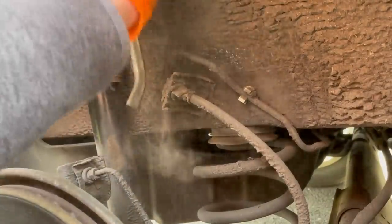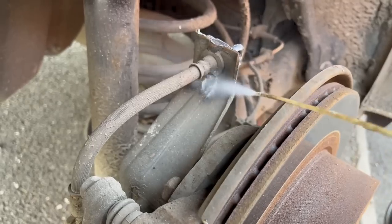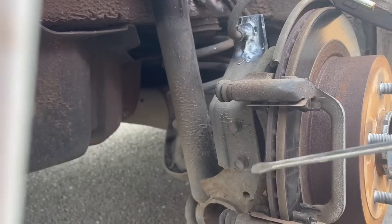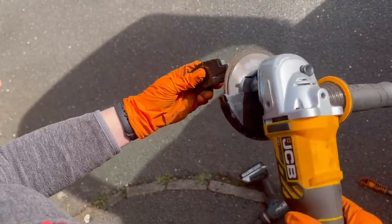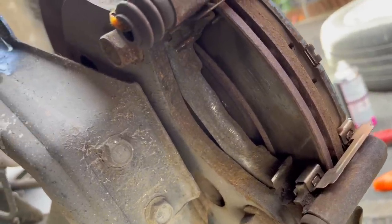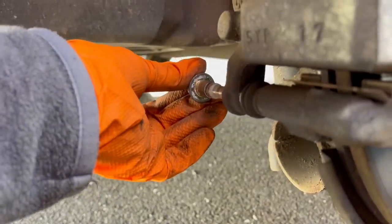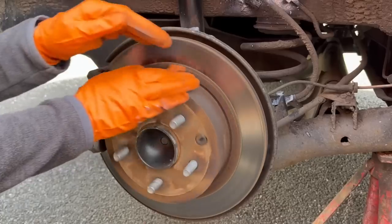Now we're onto the back wheels and here we often find the rear brake lines covered in mud and often much worse than this. There are four joints in the line that we clean up and treat as these disappear over the battery and aren't something we want to replace. It's much the same on the rear brakes as the front. The outer pads come out relatively easily, but unsurprisingly the inner pad after 26,000 miles has started to seize and needs a couple of taps to knock it free. I clean up the fitting kit with the wire brush and then use the drill for the pad wells, and I'm taking the corrosion off the pads with an angle grinder fitted with a sanding disc so we don't damage the pad. Remember to inspect the inner face of the rear disc which is largely obscured by the back plate. I'm applying the same ceramic brake grease to the rear pads, which means they won't seize up and will likely spare the owner a set of rear brakes in the future. I refit the caliper, refit the securing bolt and nip it up. I now rotate the rear disc backwards to check for bind on the handbrake — it's all okay. A quick inspection of the rear spring and shock absorber checks out, so I'll pop the wheel back on.